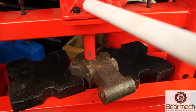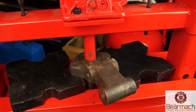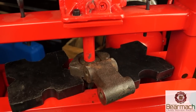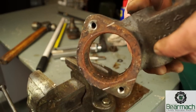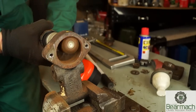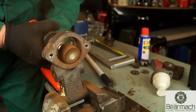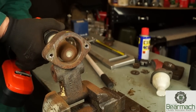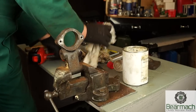If it's the first time you would ever use a press, just be warned that initially when you put the pressure on, it will build up until it releases. Be warned of that, because there is a fair amount of energy being released. So the bracket here — you'll be wanting to clean up the insides as much as possible. Don't grind it, use something like a flap wheel. Remove all the rust and corrosion, any grot that's in there. This will help you assemble it a lot easier. Corrosion will always try to hinder you.